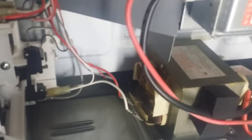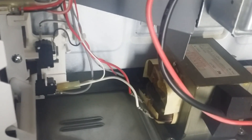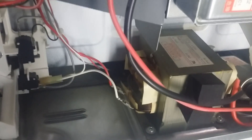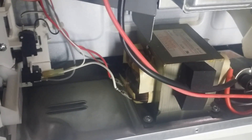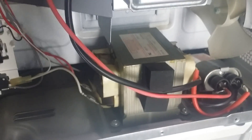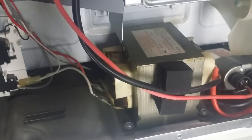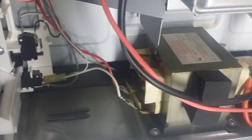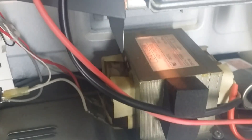After we take a moment to set the clock — on some models you have to have the clock set before they'll run — we'll put five seconds on it in case there's some kind of a problem so we can hit stop right away. But ideally, if the new capacitor is good and everything is ready to go, we shouldn't get the loud roar. We should just get a nice quiet buzz within about a second or second and a half of hitting start. Here we go. And it's a success.